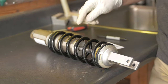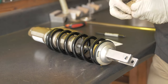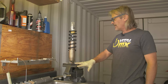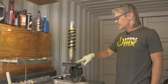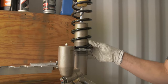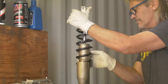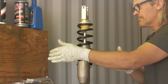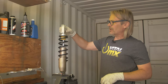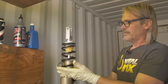After I've recorded my clicker settings, I'm going to measure the length of my spring as it's compressed. Now I've mounted my shock upside down in a vise using soft aluminum jaws so I don't scratch or mar anything. I'm going to remove the lock rings, and once I've loosened those up, I'll remove the collar at the bottom of the shock. Now I can remove the shock spring.